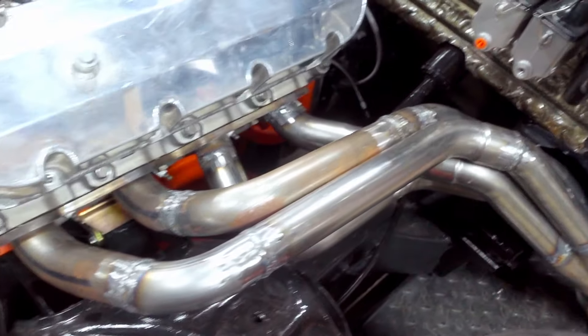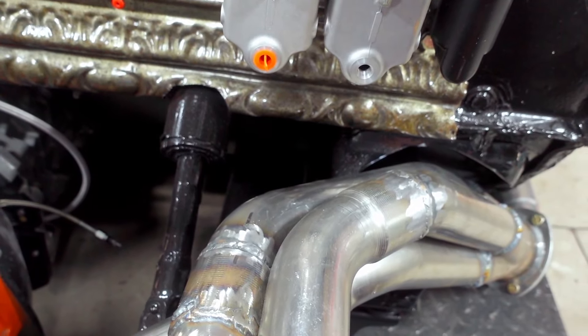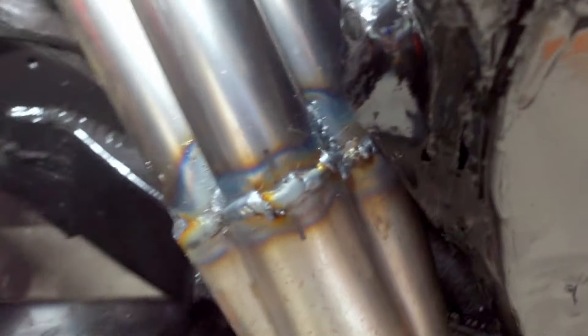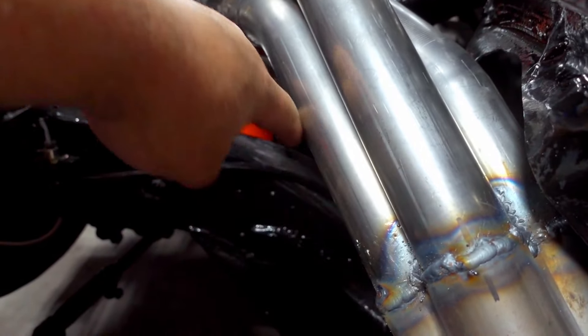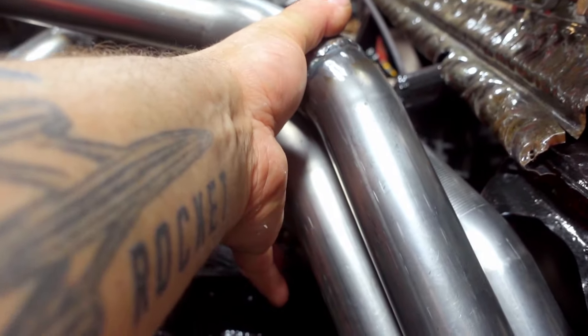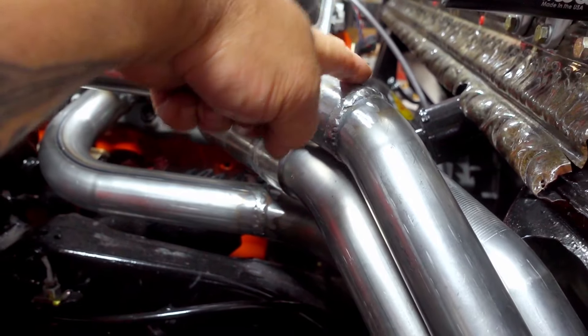Here's the other side - there's the header. My problem is I have a brake tray here, so I've got to keep clearance to run brake lines. Over here I have a steering box and I have to get down to the power steering lines. Not to mention I also have to keep room for spark plug boots, and when the tire turns all the way I needed all that room. I ended up building these headers with about an inch of room beside the tire and an inch right up in here.